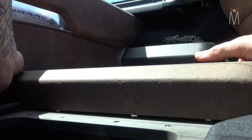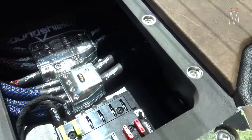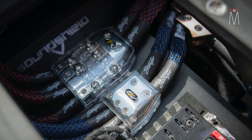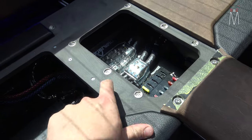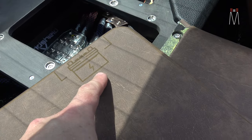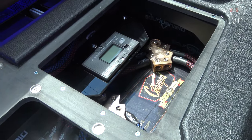There's a centerpiece that's magnetized on — pull it up and you can access the mini fuses for all the accessories I added: RGB lights, windows, door locks — all rewired and accessible right here. Below that is the ground distribution and power distribution for the amplifiers. Underneath the battery area, we have a PowerXS AGM battery along with a battery charger and tender.